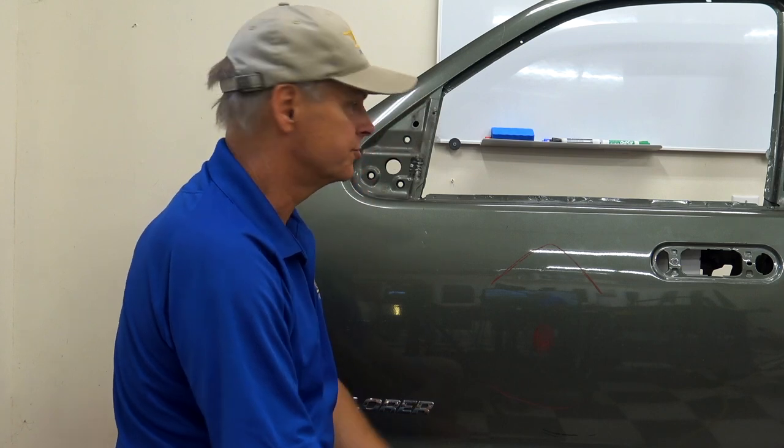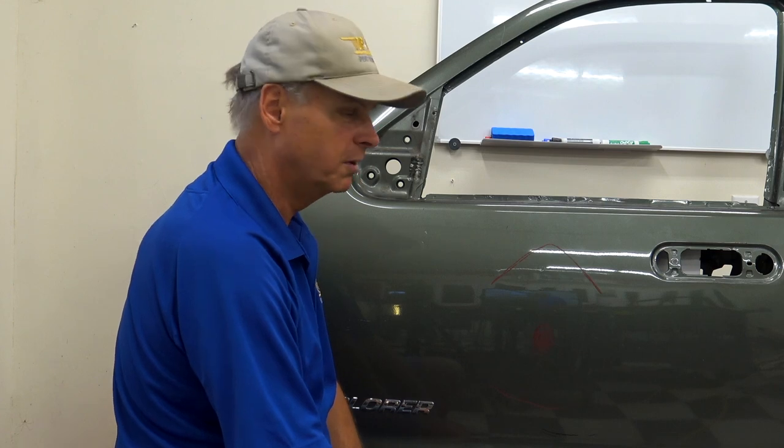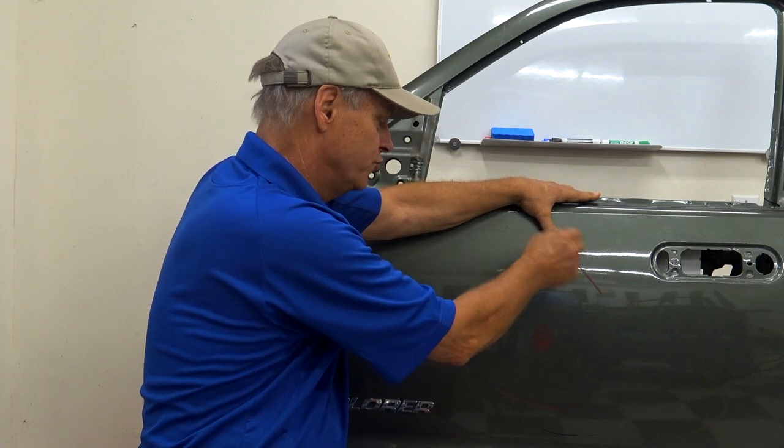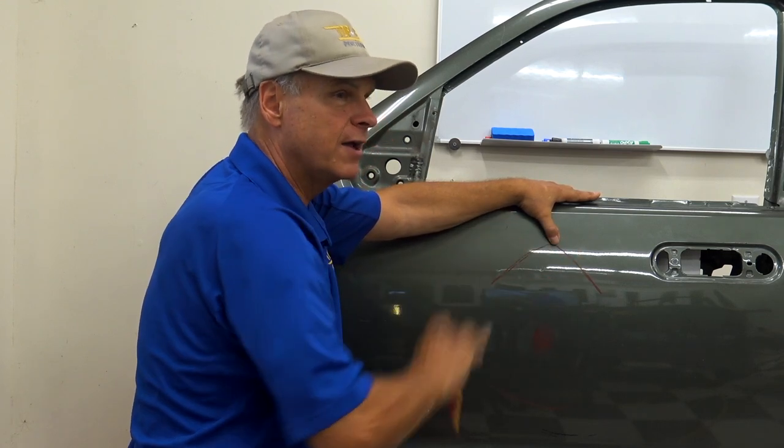And you noticed too, six months later, the car comes back and, oh my God, I know I did a better job of blocking that. You did. You left trapped metal in there. You left trapped pressure in there. So yeah, mud will not cure that. So what we've got to do is get that crown, that energy, to move back into the dent in a very fast and efficient manner.